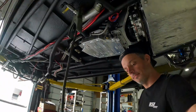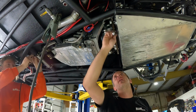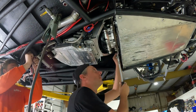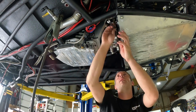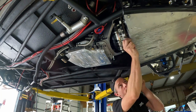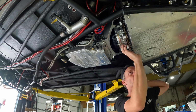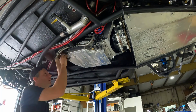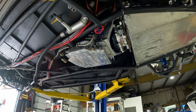If you didn't see in the last video, we had just enough clearance to satisfy M&M Transmissions. Basically, we were right on the minimum spec, and apparently they assumed we had a 1/4 inch thick mid plate instead of a 90/1000 thick mid plate. So that's where the difference in spec comes from. If we ever have to, we could have the converter milled just a little bit, which really wouldn't be that big of a deal. Or just keep running it just like it is.